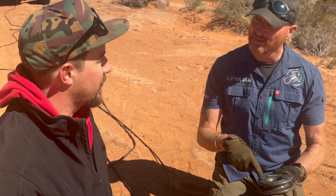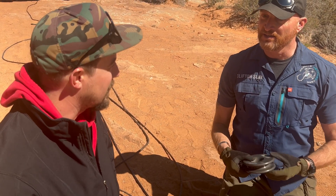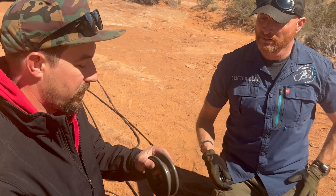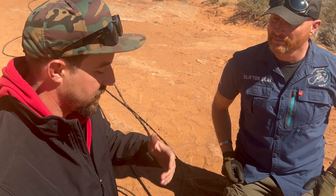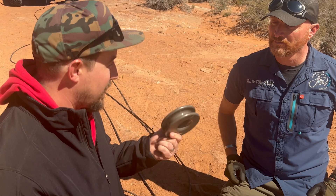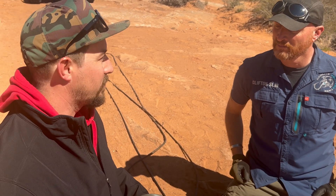This is 100% synthetics. Is this because it's billet aluminum versus steel forged, or is it a hardness issue where it'll tear it up? Yes — it's just going to prolong the life of this. You never want to put a steel cable through this either. You will cut this. This is synthetic only. We're trying to get rid of as much steel as possible. If we could make this out of synthetic, we would, but you have to have a hard enough device for the winch line to slide through.